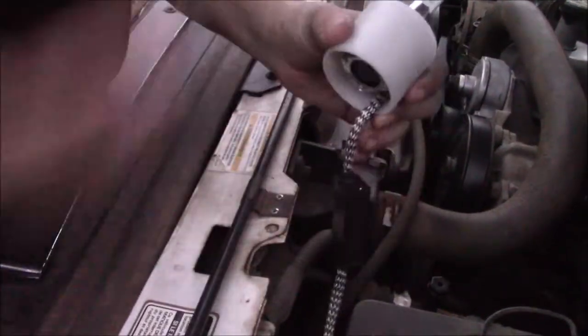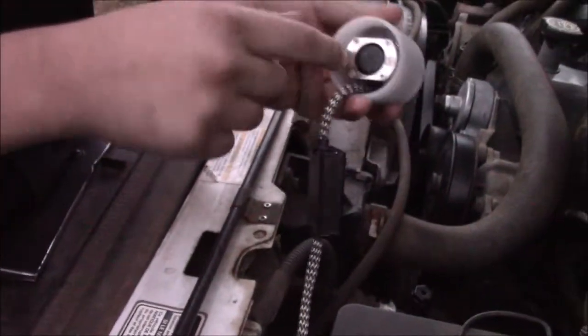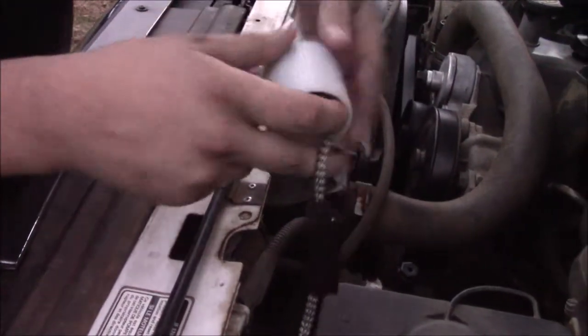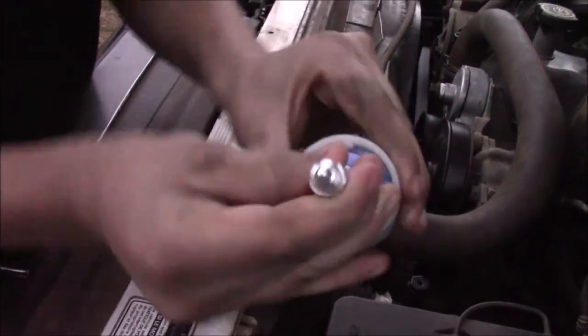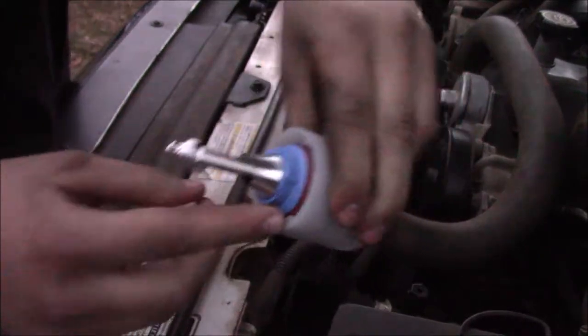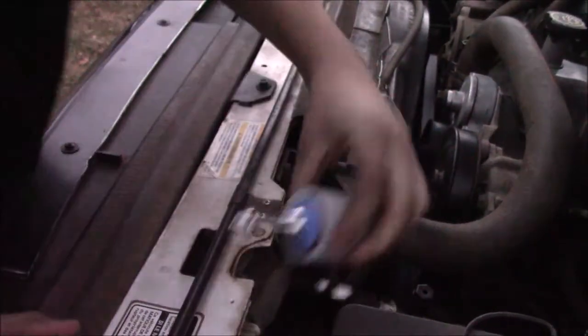How you install these — I'm just going to tell you how to do it in this particular model. You just plug them in right here. You have to kind of force this through at this end and pull it all the way up through the harness so that it clicks to the back of the bulb like this. After that, pretty much if you line up this with that notch, they'll go in straight.